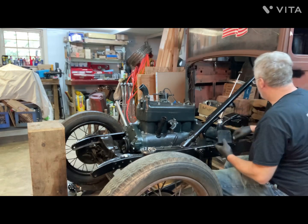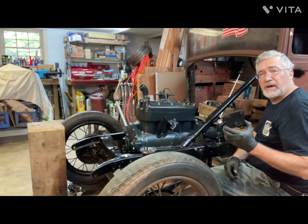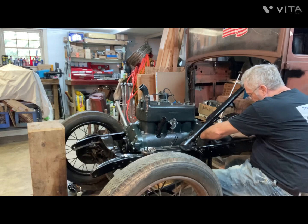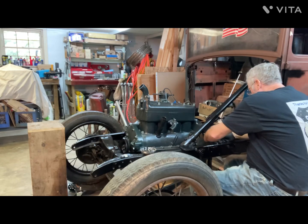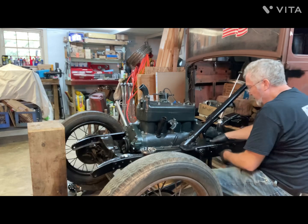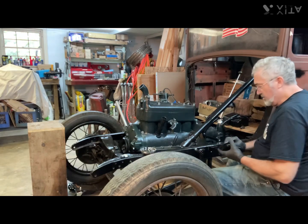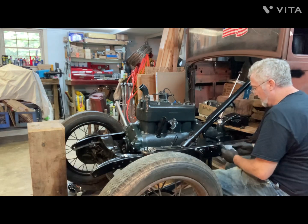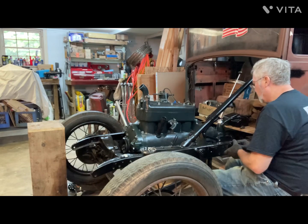So these pads, there's two. When you order rear mounts, you get a kind of an L pad with little bumps on it, and those will stick through the holes in the frame, and they have little bushings that hold it off from squeezing it down. Oh, there we go. Get in there. And then on the outside, you have this steel plate that goes on there, and they give you another pad with little indentations to go on the outside here, so that it'll float on the frame. So you don't want to squeeze it down on the frame.